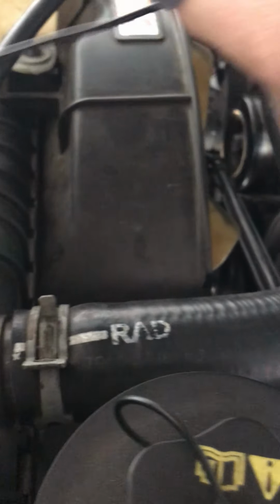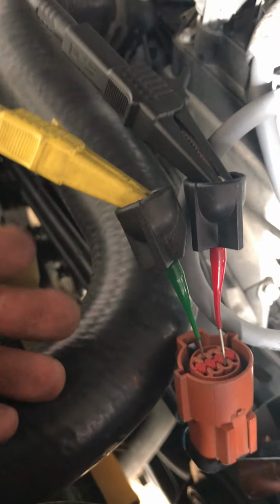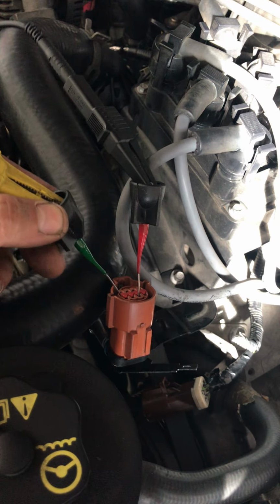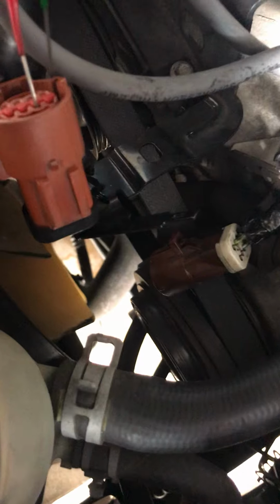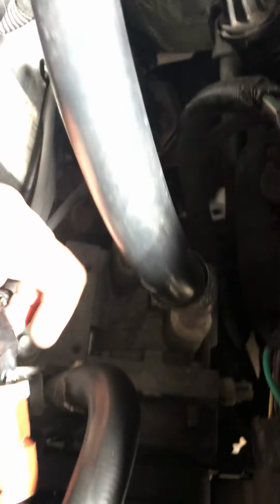So I'll take this out. Just kind of push that up so it's in the camera's view. And I will put that. Hear that sound? See, there's continuity there. That means it's a closed circuit. It's good. Don't touch the tin. See, open, defective. So in essence, basically, the exposed copper wires, when they touch, they shorted out the electric fan clutch. So even though this is a brand new aftermarket one, it's already defective. And that's the problem.